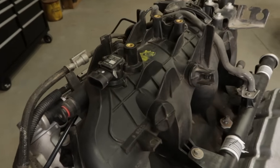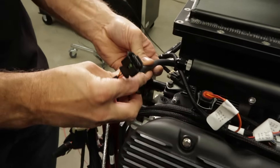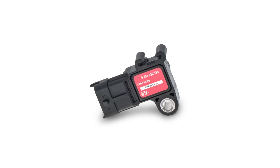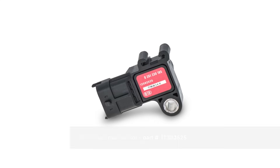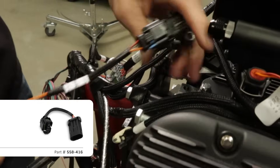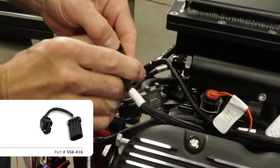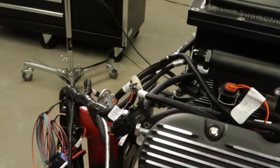If you have a stock intake, the sensor may be mounted on the intake like this one is. If your application is boosted and requires a MAP sensor capable of reading higher than one bar, we recommend the GM 2.5 bar MAP sensor, part number 125-92525. It can be used with our adapter, part number 558-416. This adapter plugs directly into the MAP connection found on the main harness — with this setup, there's no need to run the vacuum line from the manifold to the ECU.